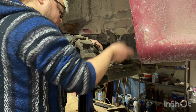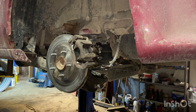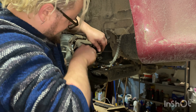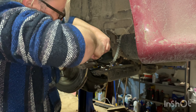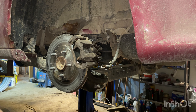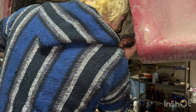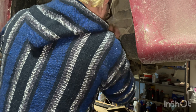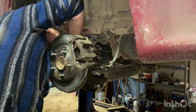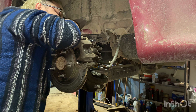We're changing the caliper so we don't really care how much we disassemble it — this is just taking a little piece off the back. We'll go over to our flathead screwdriver and pop this spring off. If you're using remanufactured, include all the hardware in the box so you can get your core price back. Pop that spring right off — easy. Now we're gonna pry this plate off the back and it is lined, so sometimes they don't really like to come off.